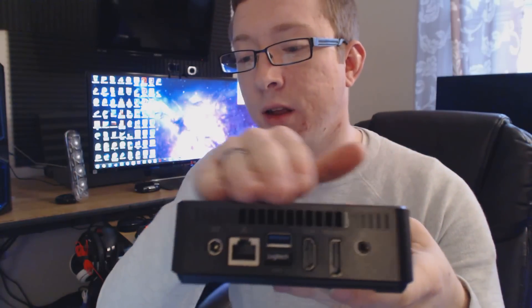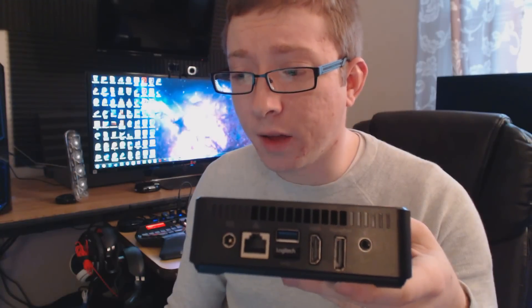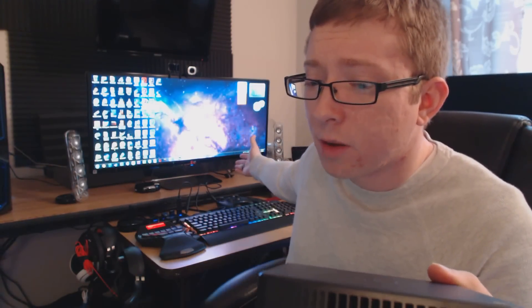There's also a two-in-one SD/MMC card reader. On the back there is an exhaust vent — this does not actually have a fan. The Acer and old Samsung models do, but the HP and ASUS ones do not. They cool with convection, and this vent just lets some heat escape. It's very very quiet — I've run this pretty hard for a week or so now and have not heard it, even though it's about an arm's length in front of me.